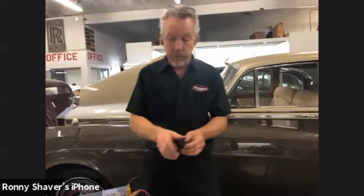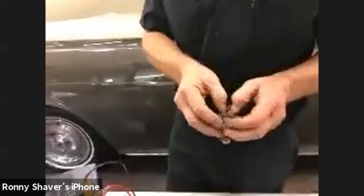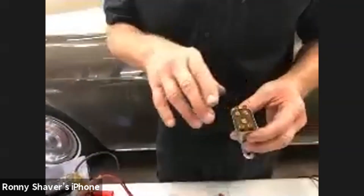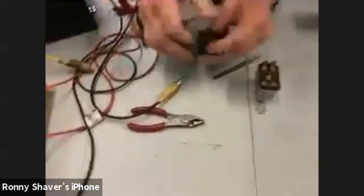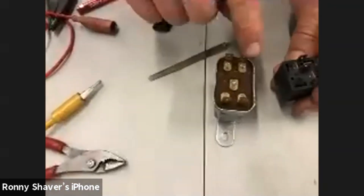That way you can get a cleaner power source close to the wiper motor. That's why these relays are right by the wiper motor — so you don't have to run all the current through the wiper switch, the intermittent control, and all that stuff. You can take your relays apart, but remember the important part: don't forget where the wires go.